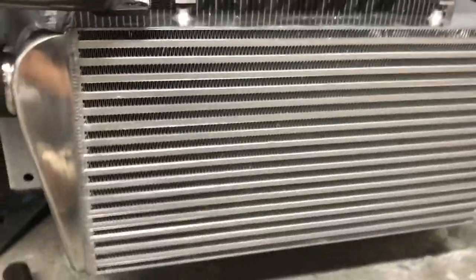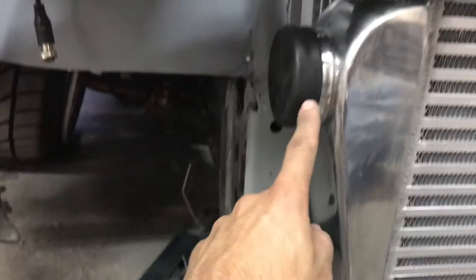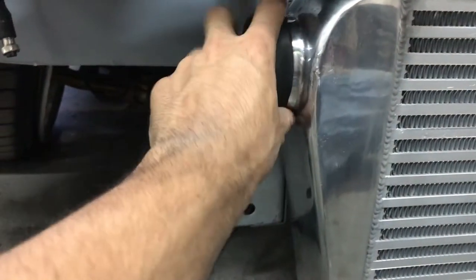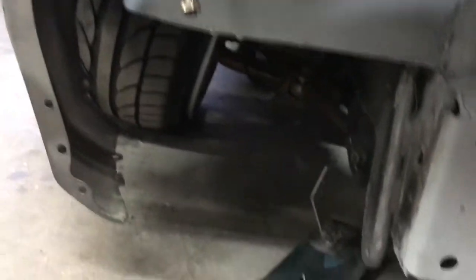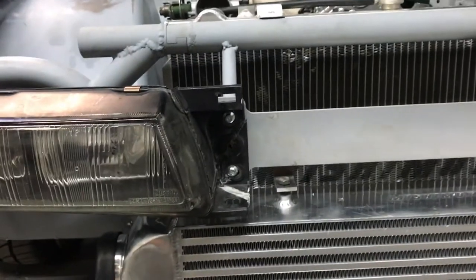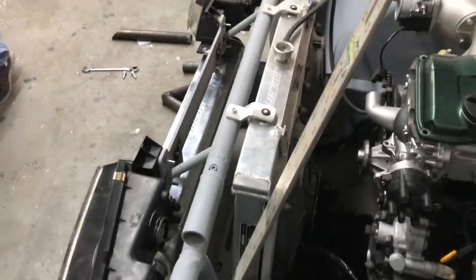All right boys, little update. I might be running this intercooler upside down because of where the inlets end up being, they're a lot closer and a lot easier to run. So it literally just 90s in and it just goes straight to it. Same thing on that tank, because before it'd be down here, have to 90 up, then over. So it's a lot shorter of a pipe, the less lag it has. Also, I got these little aluminum tabs for the radiator, so that's marked up.